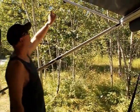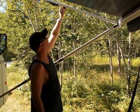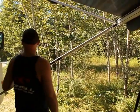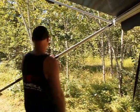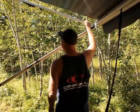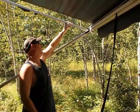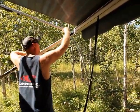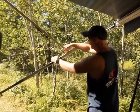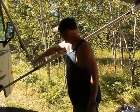How you do that is you got to loosen this knob to the left, turning it counterclockwise, and then slide that top piece of the arm all the way down to where this handle is. You got to make sure that you get this arm — a little piece of aluminum — to slide in the track. It's just like a train track kind of thing. It's got to slide in this track perfectly starting up top. Make sure this is pulled out of the way and slide it all the way down until it gets to this handle.